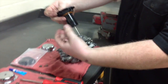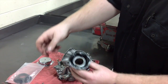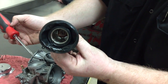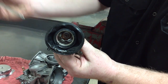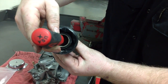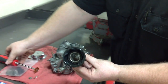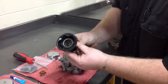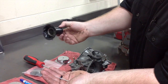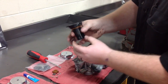I highly suggest — they don't suggest it on the site, but I highly suggest — taking the needle out first because it only takes three seconds. You literally look down in there and there's a cross-tip. Just reach down in there with the screwdriver, you don't even have to look at it, give it a twist and it comes right out. Then carefully drop your needle out with your hand. You won't bend or damage it, and it's just better overall.